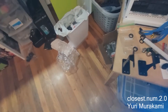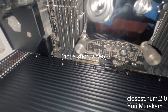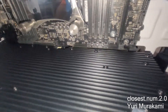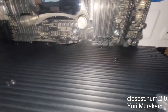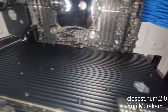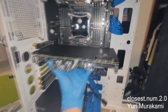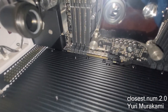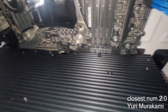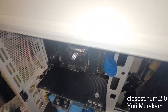Very short video here just wanted to show the issue with the Rampage 6 Extreme Encore and Omega boards — the 3090 GPU's power rear back plates hit the very bottom of all the RAM slots. I'll be using a file to file them all down.